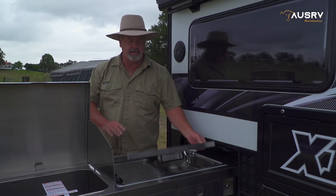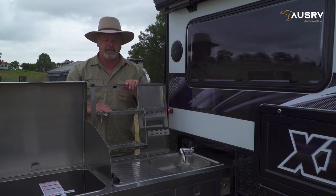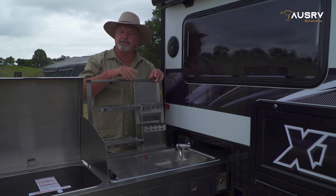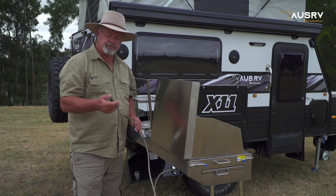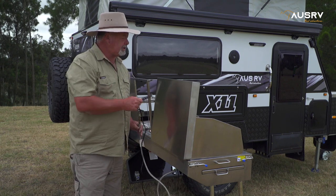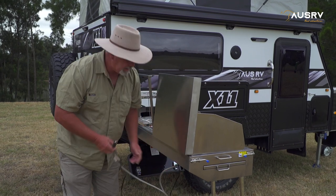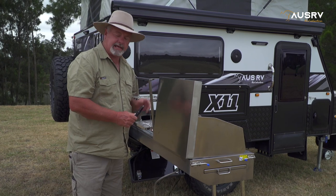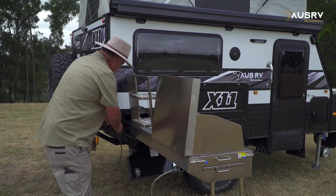Setting up the dish rack is easy — place it lifted up and fold the rack down. Now we can set up our light and plug in the electrical, gas and water. The hoses and the electrical connection for the ignition on the stove are housed in the back here. There's a hole in the back so you can get these out. The gas hose will go underneath to the gas fitting and your igniter plugged into the 12 volt socket at the back.